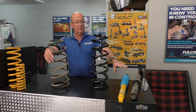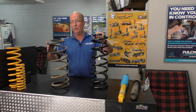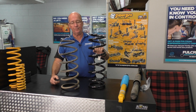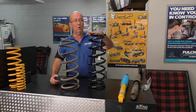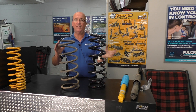The only need for a spring is to hold the car and load up — it controls body roll and the load you put in it. The original equipment spring is a good spring, built for a world market, built to last. The replacement spring is not much heavier. When we want articulation, off-road, and long travel, we don't want to stiffen the suspension too much otherwise the wheels simply won't move up and down. The replacement spring has an increase in height to lift the vehicle and an increase in spring rate to carry more load, using a cumulative rate so when under load it drops down a distance and stabilises the vehicle.